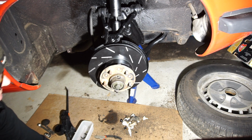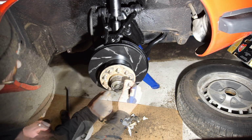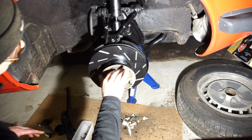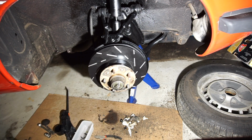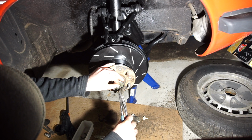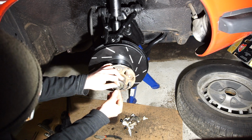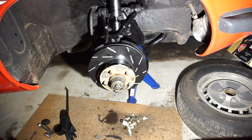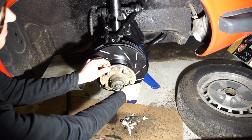That seems pretty good. So we're going to find whichever, there's so much grease here it's hard to see which, and of course we're going to fit our new split pin there, and that feels really good. No excessive play or anything like that. I'm going to get some pliers, bend that out. Snug them up in there, so that's not going anywhere, and everything still feels good.